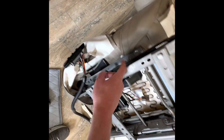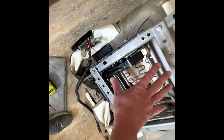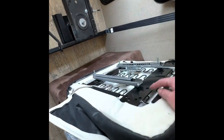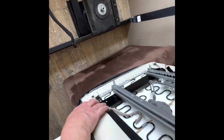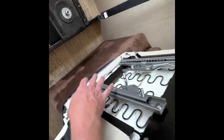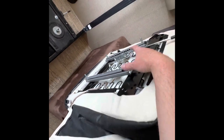Here's my seat controller. What I'm going to do is take off the four bolts holding this whole base mounting mechanism — one in each corner — pull off this electrical base, and swap it onto the new seat. There are even cutouts for other mounting options, so I can mount the electrical base on there and have all those power features on the new chair.